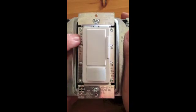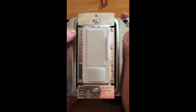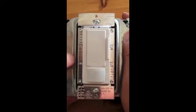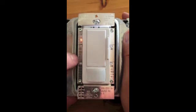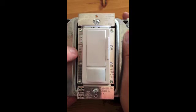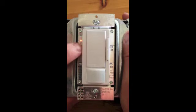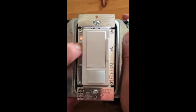So over here on the left, we're going to use these LEDs to check where we are. The LEDs correspond to the settings below — this is where we change the timeout. 30 minutes corresponds to the top LED, 15 minutes to the second, five minutes to the third, one minute to the fourth. Right now we're set to five minutes. If I want to change it to 15 minutes, I'm going to hold this down until it starts to blink, let go, then press it again to scroll through — now it's up to 15 minutes. I'm going to hold it again until it stops blinking, let go. It's that easy.